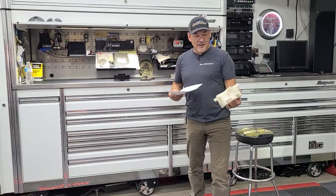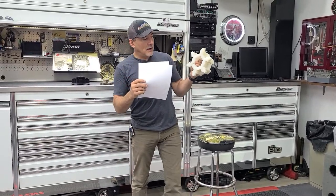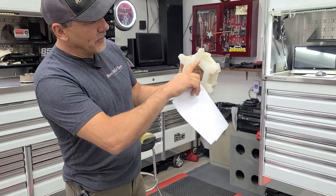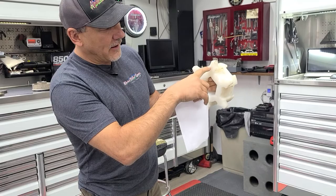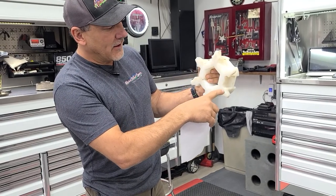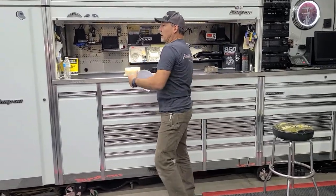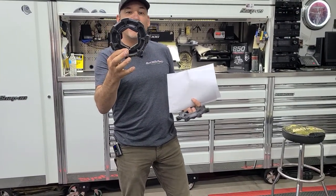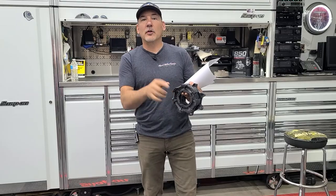So Chase grabbed an extrovert driver. You'll see that it has six teeth. On a six-tooth driver like this, there's a pretty broad spread from each one of the peaks of these teeth — that's three and a half inches around to the center of the next driver. This would be a six-tooth off of a three and a half pitch track. And that's a little bit more common this year. So it's important to know that this is the device that drives the track. More common on an OEM would be a driver like this — a seven-tooth driver paired with an extrovert in the center, a common setup.